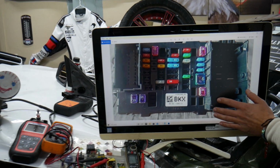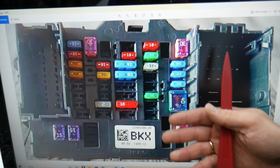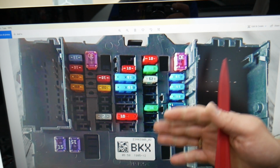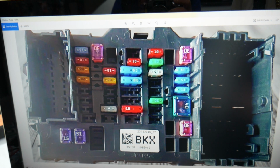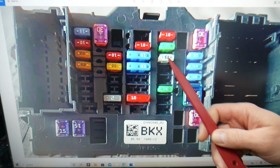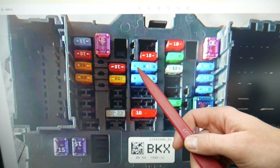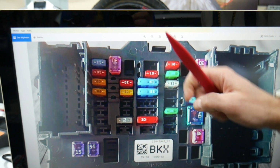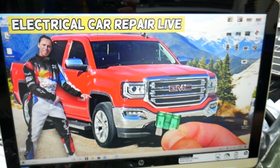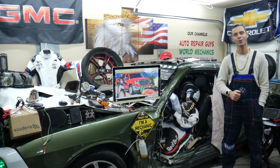Let's zoom in a little bit, right here. Okay, perfect. 2018 model year GMC Sierra fuse boxes may differ very slightly, but for that fuse that we need to check for the USB ports, it will be the same for all years. The fuse that we need to check today is known as fuse number 27. We're talking about this double 15 amp fuse. That's a really hard to find fuse, that's why we recommend to get some spare ones. We'll share the information in the description of the video below where you can get them from. That's known as a micro 3-blade fuse. What about the relay? You don't have a relay. A relay function practically is controlled by the BCM, known as the body control module.